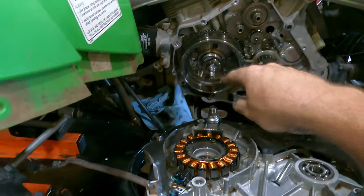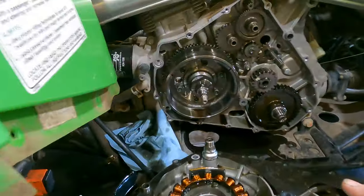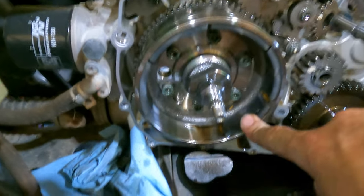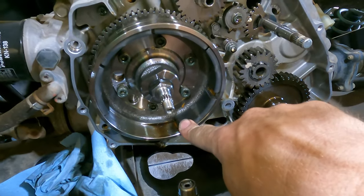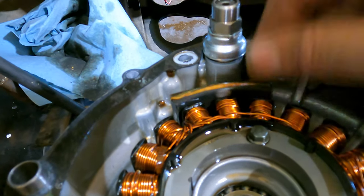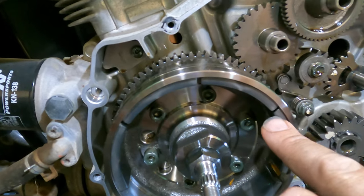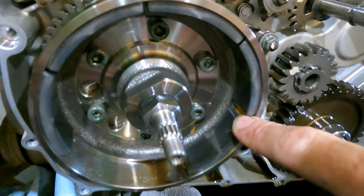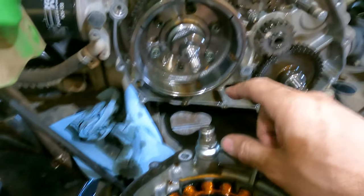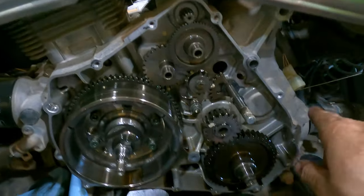We're on the left side, the stator side of this thing. I took all the bolts out, drained the oil, removed the oil cooler hose and everything. Right off the bat, as soon as I opened it up, I saw a magnet was missing. What happens is these get really really hot, the glue goes bad, and the magnets start to either slide apart causing intermittent spark, or get sucked up against the stator like this one, losing all spark. You can see there's a nice little gap in them. This is the first one I've had where the magnet has come all the way off and stuck to the stator.